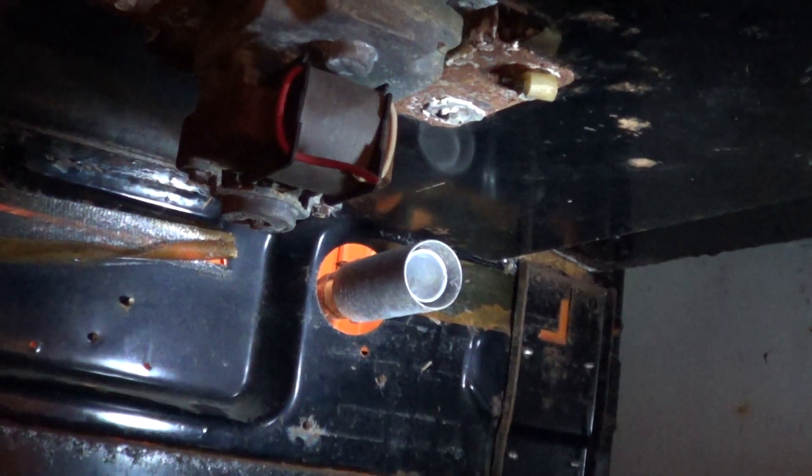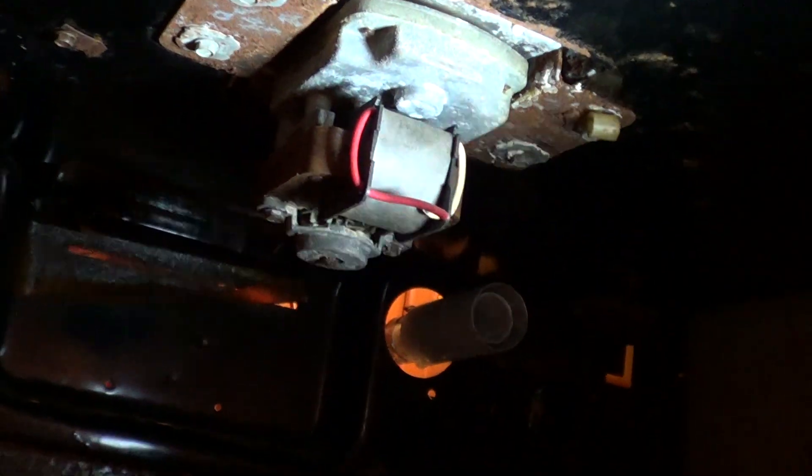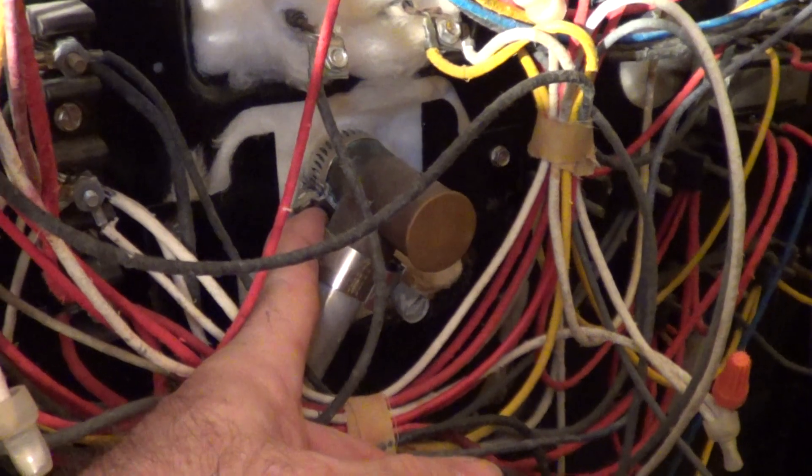That's the feed point, routed from the microwave going to the back. This is the motor here for revolving the tray. There are a whole bunch of different interlocks on this. The microwave from the magnetron feeds through this tube, going up through here — it almost looks like a water pipe, about one inch in diameter — and this feeds the antenna. So this is on a 915 megahertz oven.